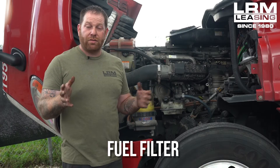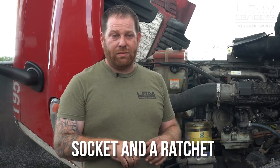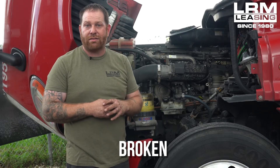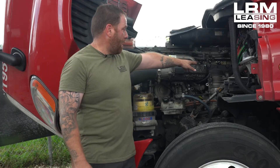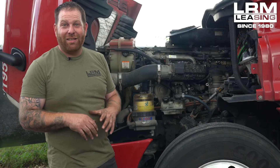The next one is fuel filters. If you guys had fuel filters replaced not long ago and you have a hard start situation, let's think about it — you didn't have the problem before, now you have one. Go back where it started from and take a look at the fuel filters. You guys can do it yourselves with a socket and a ratchet. The fuel filters are right here. Make sure the O-ring is not pinched or broken, because that's usually what I see. You'd have to get new fuel filters, and there's a priming pump right there — I threw another video on how to prime your truck to save you guys money.